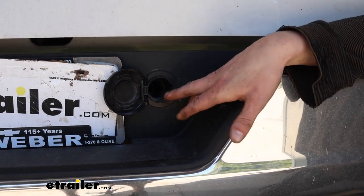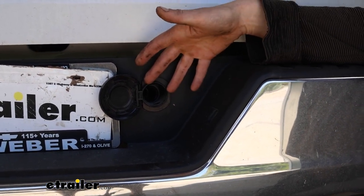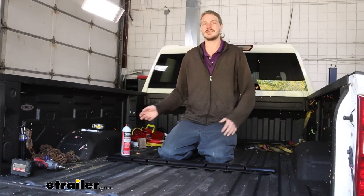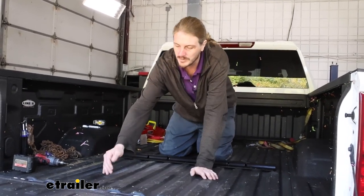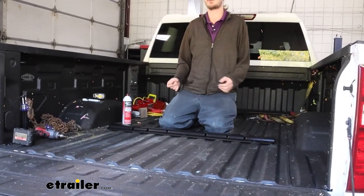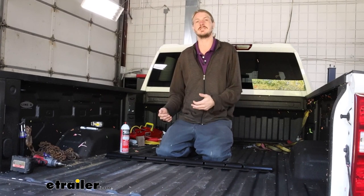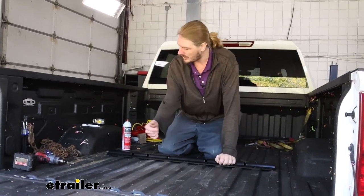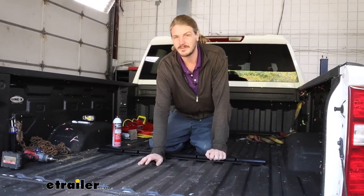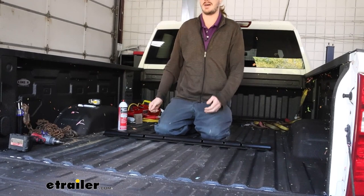Your tools in your truck will slide in through the point back here — there's probably a lock in there and you use your ignition key to open it. If you refer to your owner's manual you should have all the procedures in there for where your tools are located and how to utilize them. We'll begin our installation in the back of the truck — we'll need to center the rail side to side and then measure from the rear of the truck bed, not the tailgate but the actual bed, to the appropriate distance and make our mark. That distance will vary depending on whether you've got a short or long bed truck, so make sure you refer to your instructions. Now this is a pretty thick spray-in bed liner and you might want to add just a little bit of extra length — maybe a 16th or 32nd of an inch — just to compensate for the thickness of that coating.